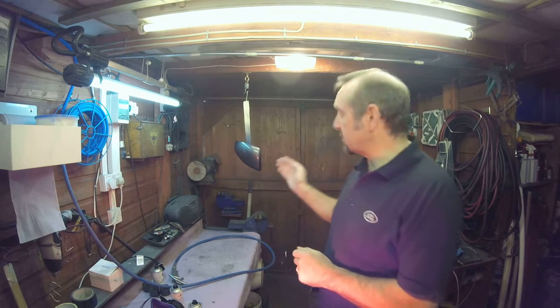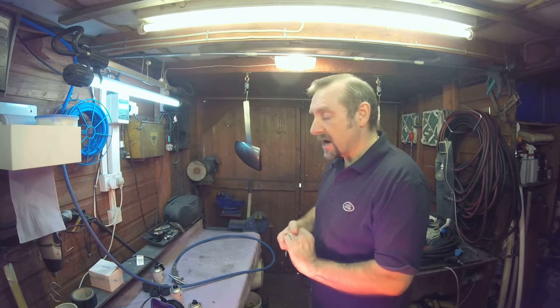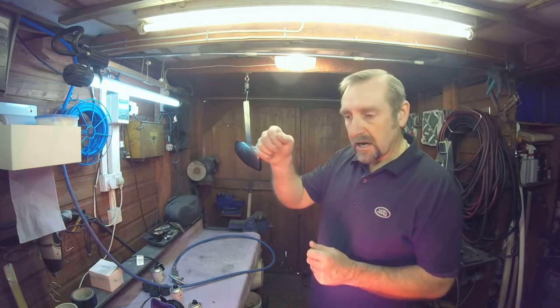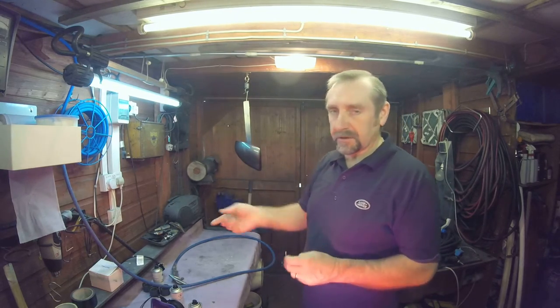And then we'll put 2 coats of lacquer. Because the base coat is very fine, there's no texture in the base coat, I will only need two coats of lacquer. So I'll put 1 coat on, which is called a closed coat, which will seal the whole part. Let that flash off for a good 10 minutes or so. Do a thumb test on my lollipop so I can see if the paint is ready. If it leaves your fingerprint, it's too wet. As soon as you get it to that tackiness, as it doesn't leave a fingerprint, then we'll put the second coat on.